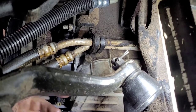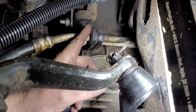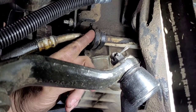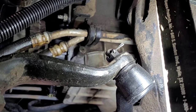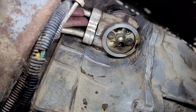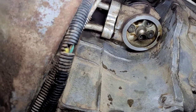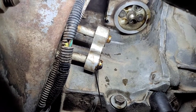At the front of the engine block on the driver's side, there's a little bracket right here that holds in these oil cooler lines. The bolt takes a 10mm socket to get it out. The lines aren't going to come out any other way, so you've got to take that little bolt out and the bracket should just come right off. Then these lines should just pull right out of the oil filter housing. I have the bolt out — the one that actually holds the little line manifold to this housing — and I took the bracket off the front. So now this should just wiggle out, and it's going to leak some oil. You probably want to let it sit there and drain for a while, because there's going to be a lot of oil on the lines and the cooler.